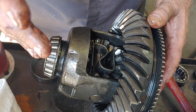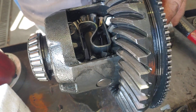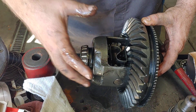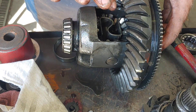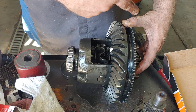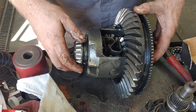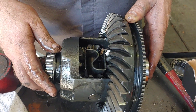On the posi, on this positive traction or limited slip, you see that this is a spring which presses up against them, because on the other side of these gears is a little clutch — little clutch disc, little clutch materials on each side. That causes it to always have pressure on there, so when your axles go in, it causes both wheels to turn at the exact same time. Now if it was what they call an open differential, it would not have those inside of it — it would have the spiders, but it wouldn't have the clutches or the little clutch discs and spacers. So one wheel would spin freely and the other one wouldn't do anything. The difference is with a traction lock or anti-slip differential, both wheels turn if you're in a slippery spot. If you have an open differential, the one that's going to spin is the one in the slippery spot — the other one won't do you any good getting out. That's why you need a positive traction differential.